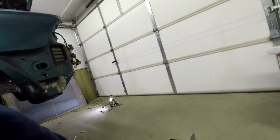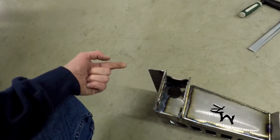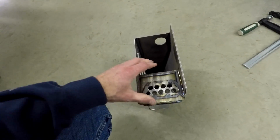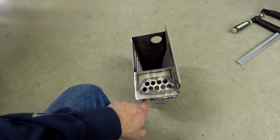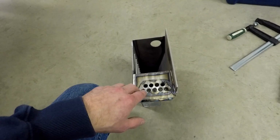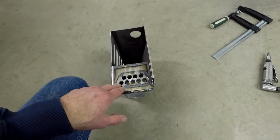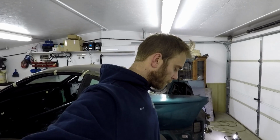If I couldn't put the bolt through, I just grabbed a 1/2 inch drill bit. Make sure the drill bit is long enough to get to both sides, because you have to go from this side in order to maintain a straight shot. But I didn't go nuts. I just got it through the first hole and got it in position for the second hole, and then just real lightly, high speed but low pressure, I cleaned everything up so that the bolts fit through real nice. So I definitely recommend doing that check.